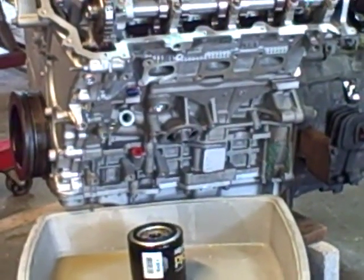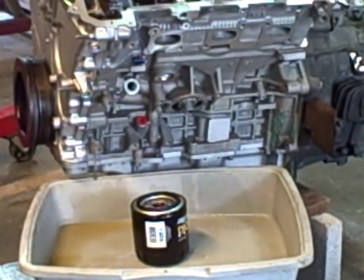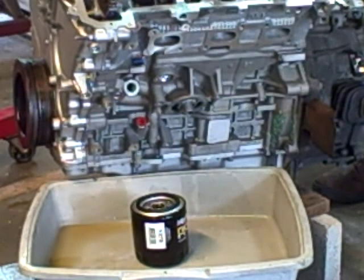I'm going to crank the engine again. I'm not getting anything — no oil out of there. So again, just documentation, then I'll have to contact the supplier. There's five quarts of oil in the crankcase. Here we go.